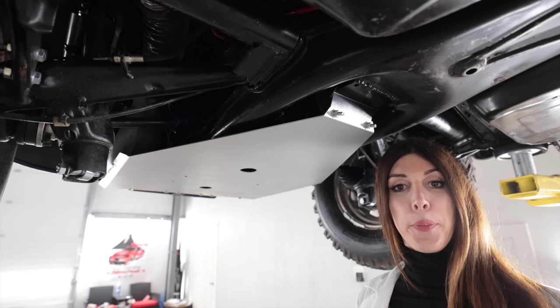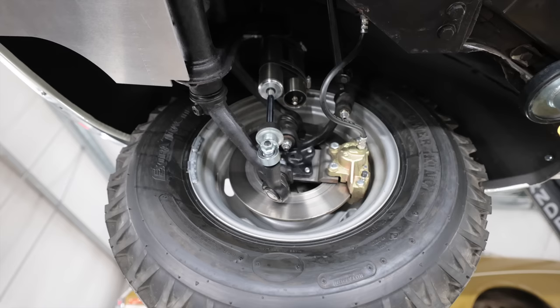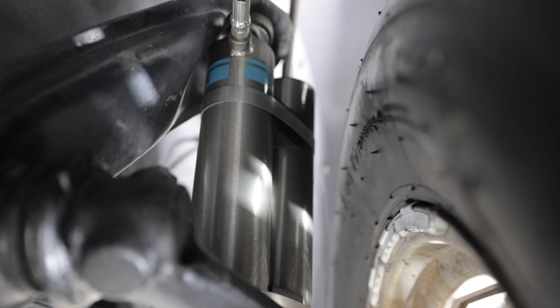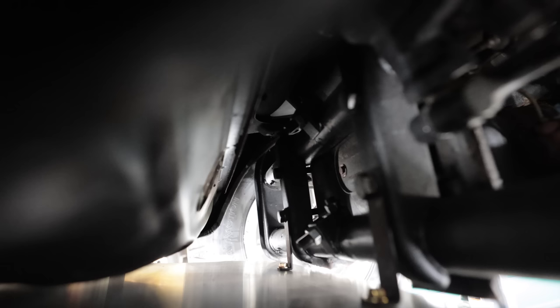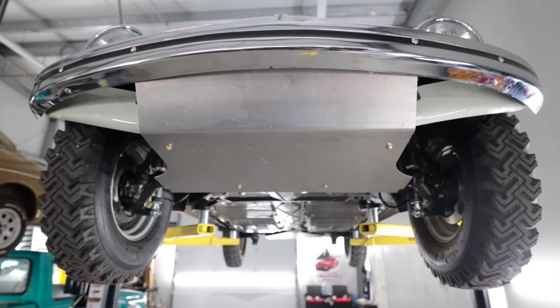There was also an optional automatic in this car — I have no desire to see what that was like. Up front, you have a transverse torsion bar with upper and lower trailing arm suspension, and you can see those remote reservoir Bilstein 7100s again. I had the front axle modified at Churco here in Tucson, Arizona, with fully adjustable ride height capability — you can have it lifted like it is now, put it to stock, or technically slam it if you wanted to, and adjust the rear with the torsion bar to match. I also added a custom aluminum skid plate designed to help protect its beak from stones.